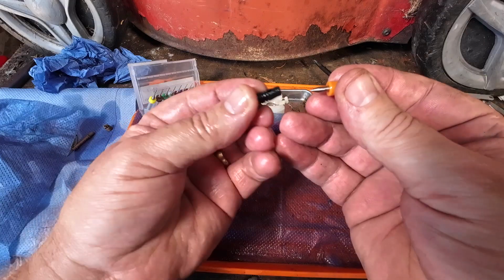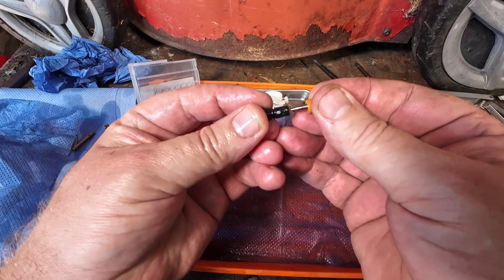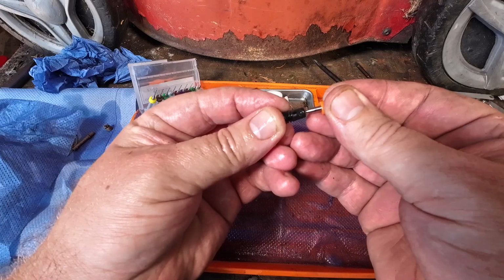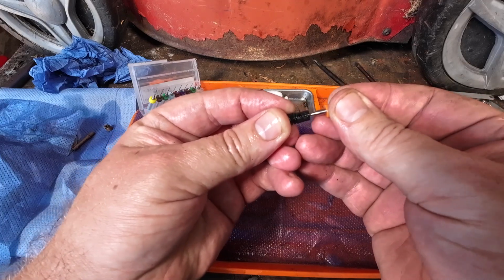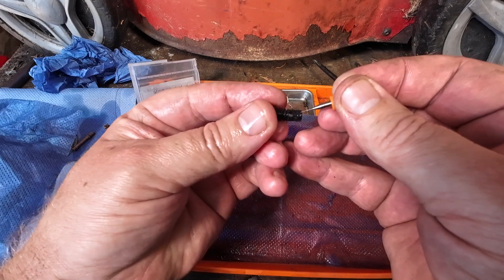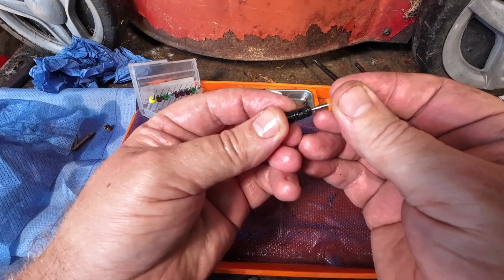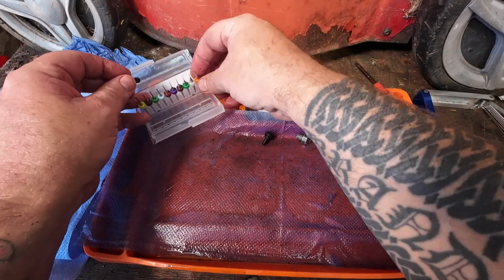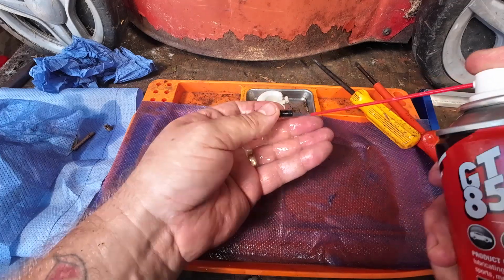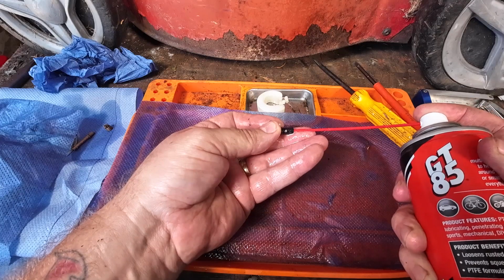Now, very, very gently, because these like to snap. Sideways pressure on the inside circumference of the jet. And we're using this drill bit like a file. Just adding pressure to the wall. Now there's a little tiny O-ring just on here. There's an O-ring further up as well. Okay, they need to be in place. If they're not there, you're going to have problems. So sideways pressure, put my drill bit back, because I need that for next time. Get my GT85, clean my thingies, push that through the jet, and you'll see that jump through the hole. There you go. Isn't that a beautiful thing?